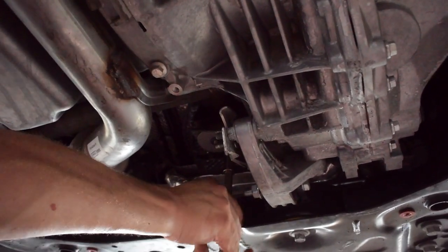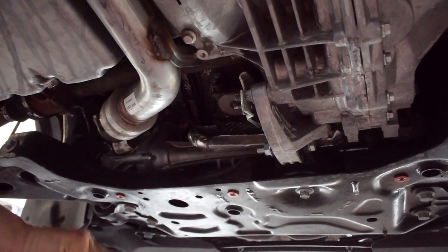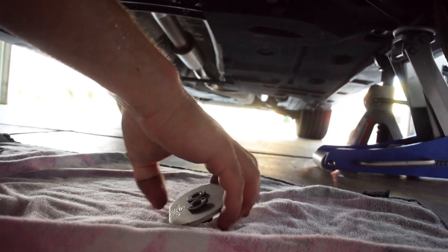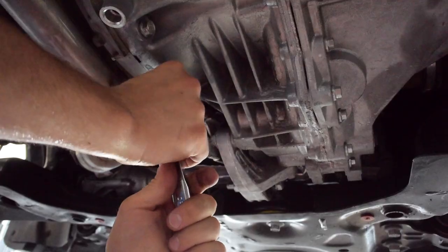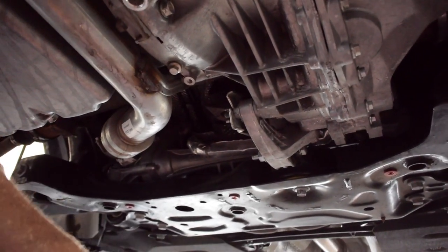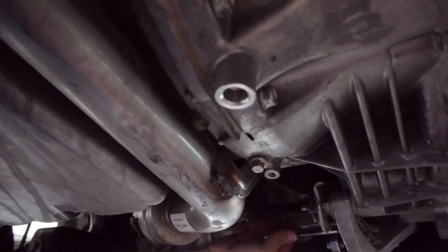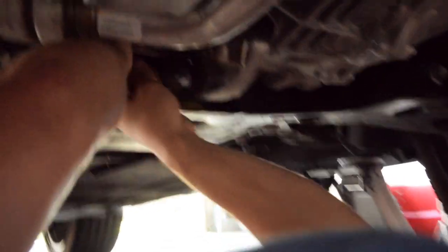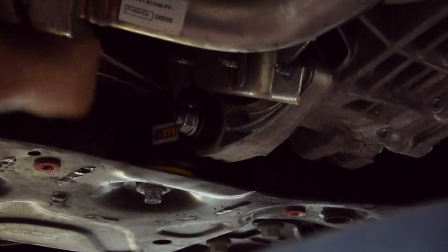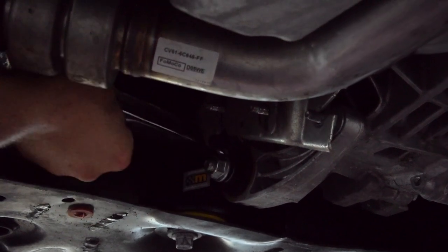Some of these parts are going to be really hot when they come down. And I think this thing is just going to possibly fall right down here any second — yep, there it is. It's hot as all hell, a hundred plus under this car, easy — 110, 120 degrees. A pair of gloves, but I couldn't find them. Golf gloves — Foot Joy would like that. We need a ratcheting wrench for this. If you just have a regular wrench and have to constantly pull it off to reposition it in this tight space, that alone would take 20 minutes. Good pro tip.